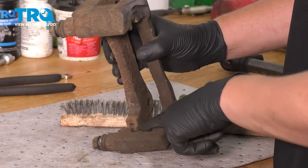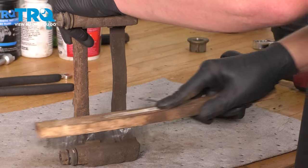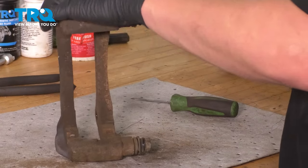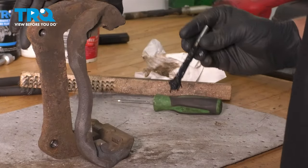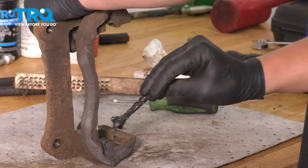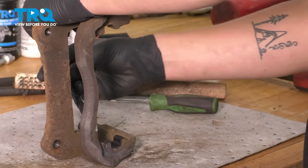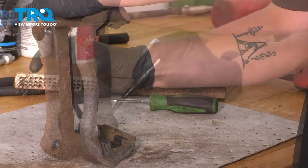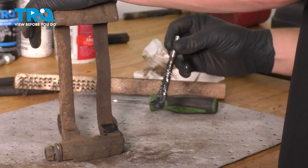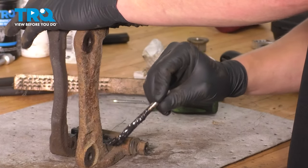Using a wire brush, clean the channel and just on top of these — anywhere that the metal shim is going to sit. Do the same thing on both sides. Put a small amount of grease where we just cleaned. When I do this, I like to pull out and not brush towards the inside, just in case I get any grease on the inside that might get on the rotor. You want to try to avoid that as best as you can.